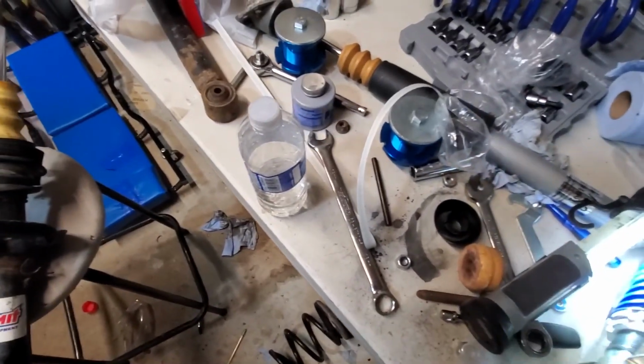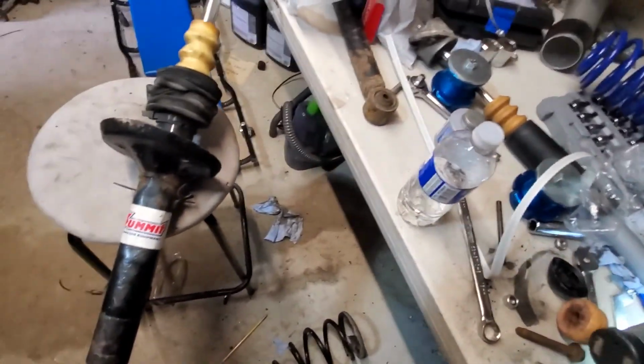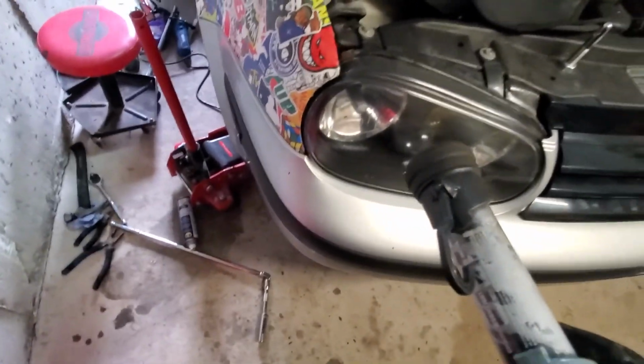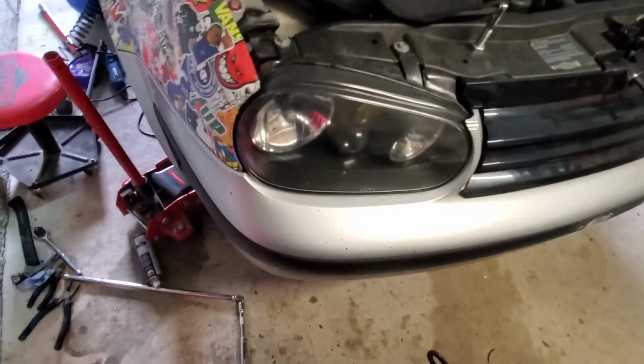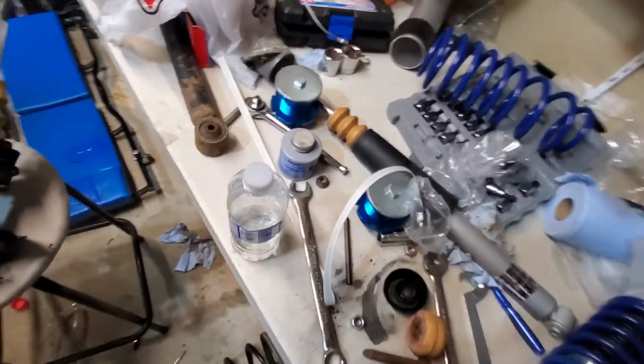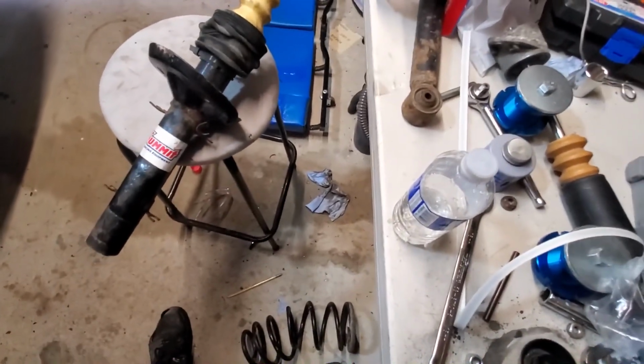I didn't know what else to do, and I'm sure if I went underneath and also undid the CV bolts for the gearboxes, but I didn't have an M8 triple square, so I wasn't able to do that. I had to borrow the axle nut socket, which is a 30mm 12 point.